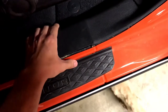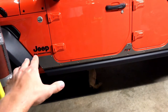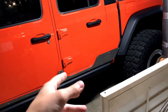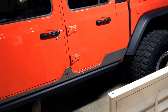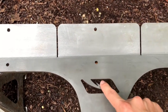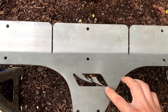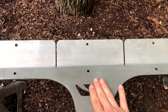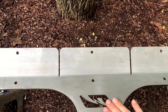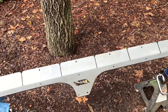There's a gray plastic frame under here that doesn't look like it's going anywhere. I'm going to pop this back in and find some larger clamps that'll go behind here. We're probably going to take the doors off to prevent scratches and get better access when clamping. Something I did notice was the back side of this logo they cut out — it's got some sharp edges, you can kind of see it sticking up right there. I'm going to take a flap disc on my grinder and smooth that down so it doesn't wear into the body and make raw metal spots.